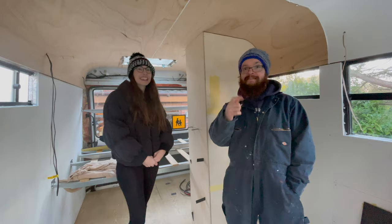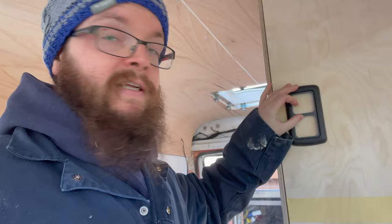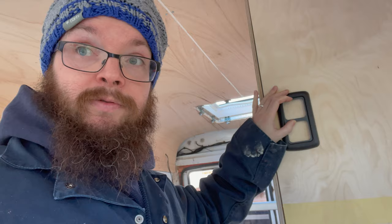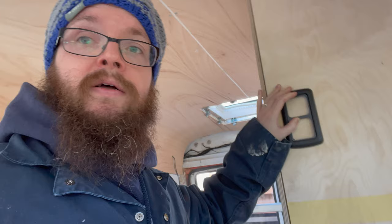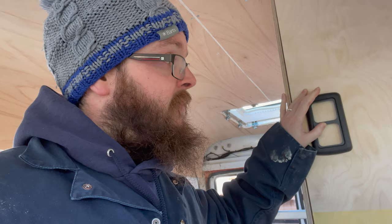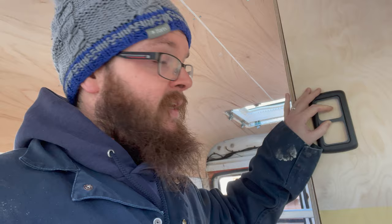At the end of last week's video we gave you some sneak peeks. Basically this week we're starting by installing some more cable and plugs. So on the end of here we're going to have a dimmer switch for our mood lighting and a switch for our water pump, which also integrates a light switch for our main living area lights.